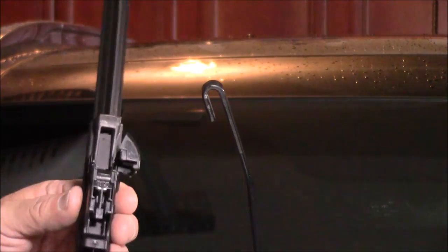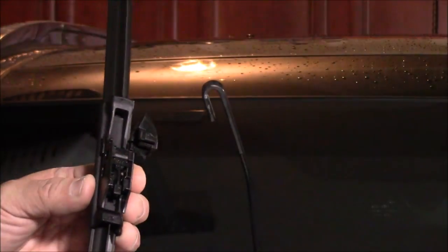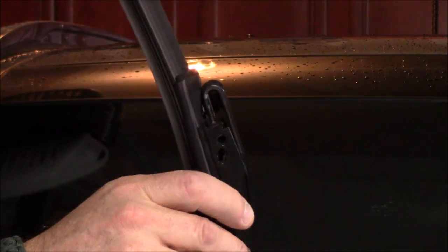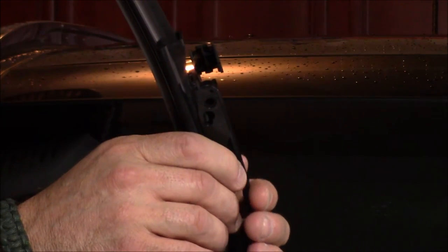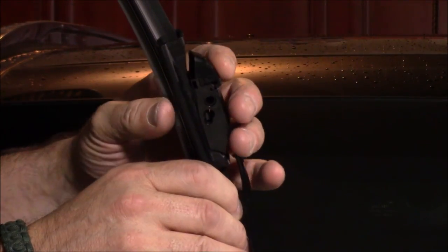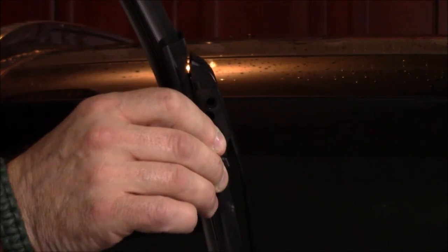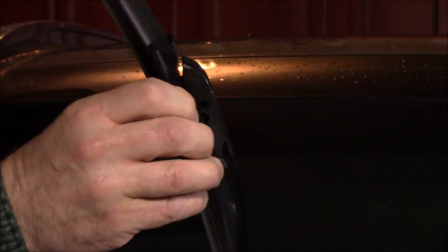The passenger side wiper is the exact same procedure. Make sure the door is open on your wiper clip — the primary lock and secondary lock here — and slide it up through the hook like so, then lock the secondary lock. Make sure to test fit it, confirm it's nice and secure — and it is. At this point, just lower it down onto the towel, then remove the towel and test your wipers.